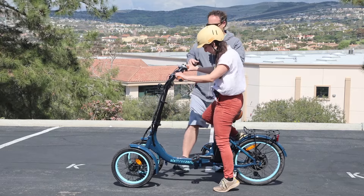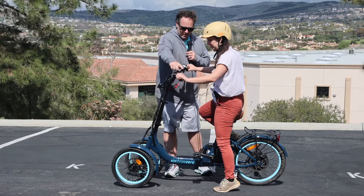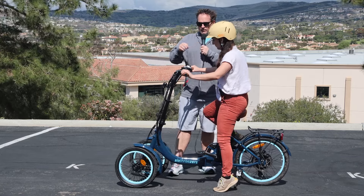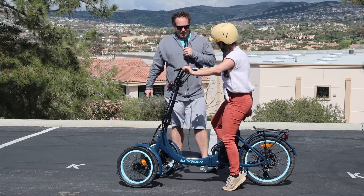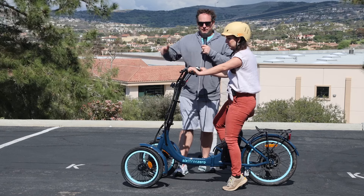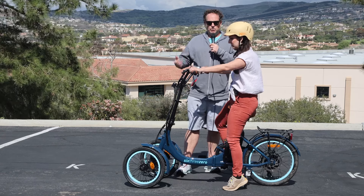She's never been on an e-bike. This is your power button here — hold that. Now the screen is on. If this is in level one, you get assistance — that's the lowest level. Pedal assist level one is the least amount of assistance. You can move that up through five levels of assistance and change those while you ride. This is actually a throttle — you can push that with your thumb like a gas pedal, and it will go without pedaling.